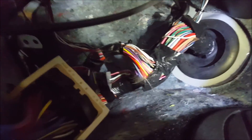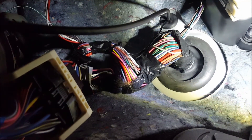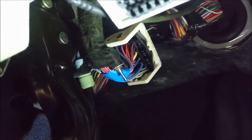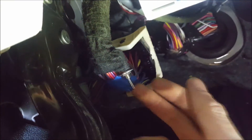When a remote start is complete, it should look nice and tidy — you're looking at mostly factory wiring. There's some of my wiring like the hood pin coming through. See if you can detect where the hood pin wire is coming through in the comments. I have my valet switch here — I tape it onto an existing harness rather than drilling holes in panels. People end up kicking switches drilled into panels. Taping it makes it easy to reverse if needed, still easy to access, and the mechanic can flip it to disable the whole system.